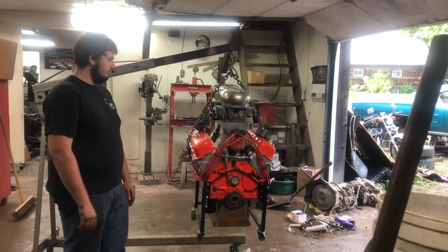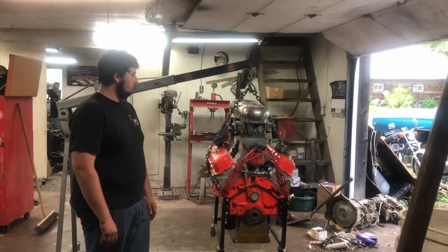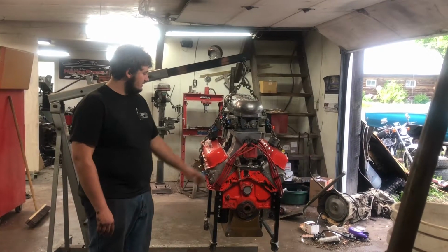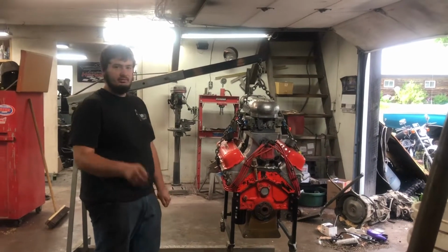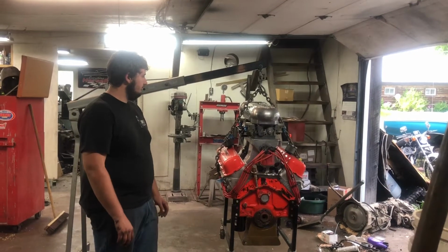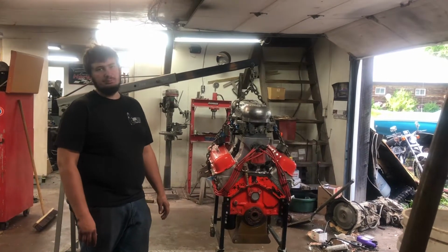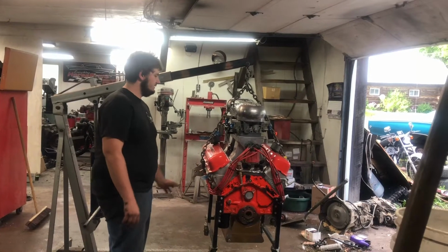You didn't have that on the 427. But 454s did. So we're not dealing with that garbage. And then these are BB2X 365 heads. We did a little bit of a bowl blend, not a port match, and some work around the valve job, lapped the valves, checked the valves, all that wonderful stuff, put our big old springs in it. And then it's got the T&D shaft rockers, all that business.